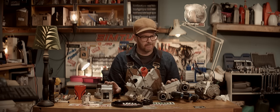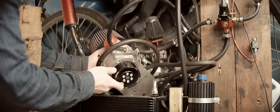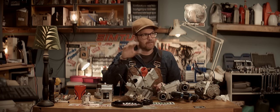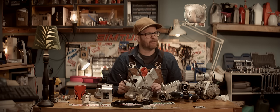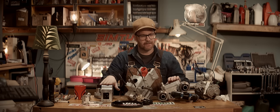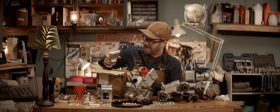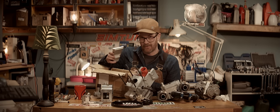The problem with all that blower - how it's always been operating on the surge side of the surge line. We'll need to install a mass airflow sensor and a MAP sensor. And since this will behave pretty much like a four-stroke, just stroking twice - meaning twice the firing events - people are pointing out we can go pretty easily with a blown four-stroke EFI type setup, which would work here. But I don't think this is the way forward. I think something like Megasquirt or Microsquirt with injectors into the transfers - to not have a huge carburetor setup.